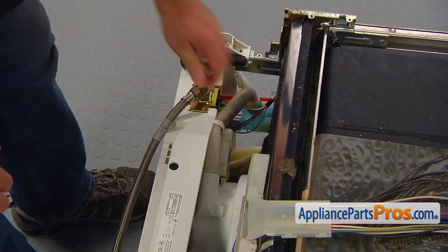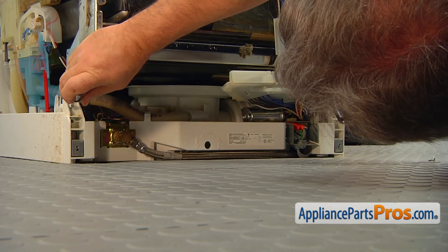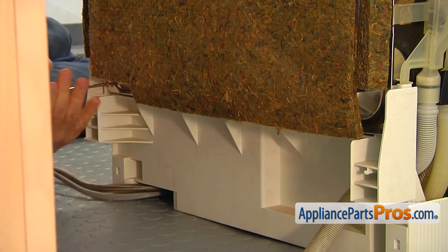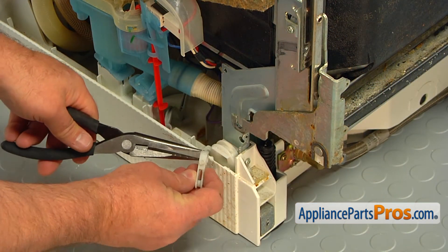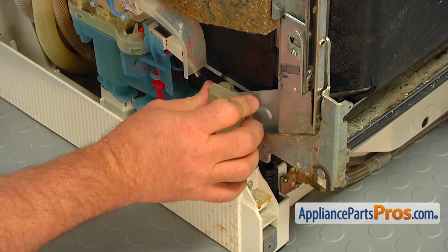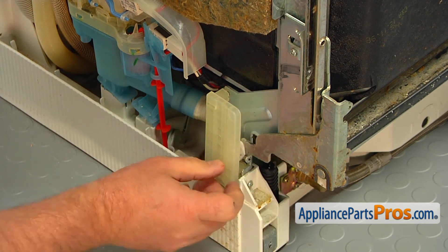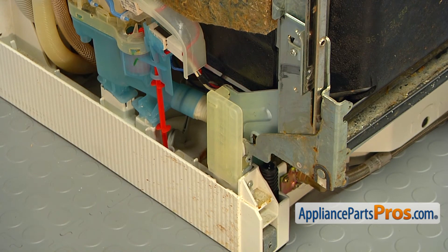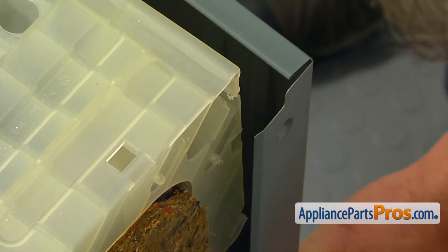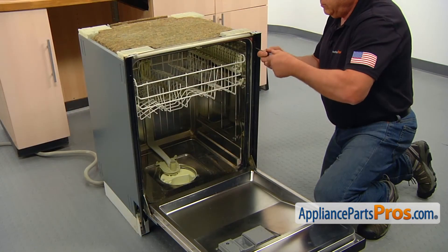Lock the terminal cover down and slowly raise the dishwasher upright. Secure the base to the dishwasher cabinet with the two Torx 20 screws in front and two at the back. Using the needle-nose pliers, reinstall the hinge rope hook on the hinge and install the hinge rope cover. Repeat the procedures on the other side. Install the side panels — first the bottom, then the two plastic tabs at the rear — and secure them with the four Torx 20 screws.